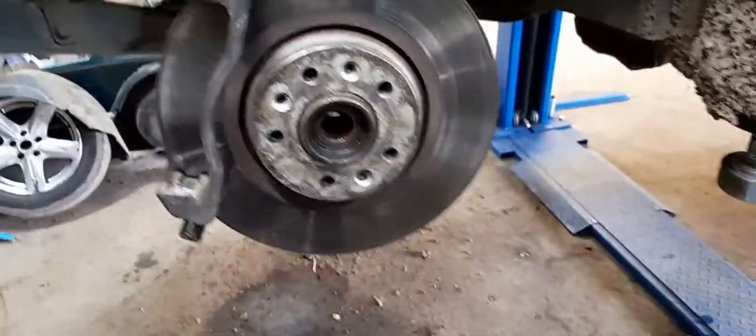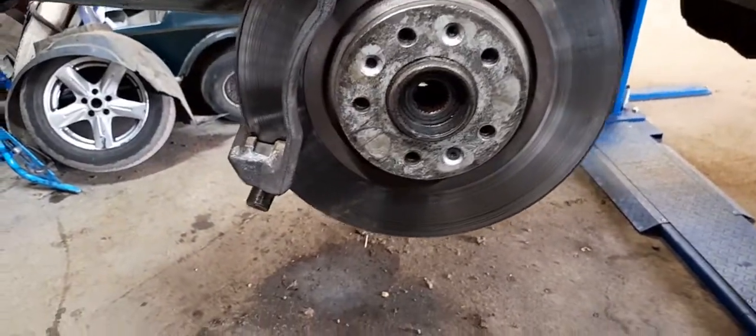Just a quick one — I've got a Fiat Scudo here doing a bottom arm replacement. These things are a bit of a nightmare to get in, so I thought I'd do this video and show you how to do them and make life easy. The easy way to fit these is to make sure they're perfectly level when you fit them, because if not, these bolts don't want to go in and you'll spend hours messing around trying to get them to start on the threads.